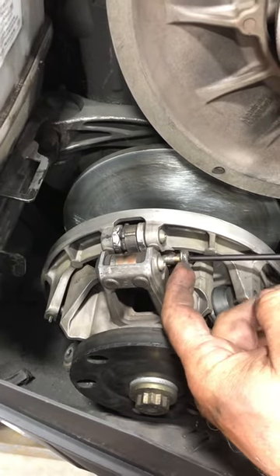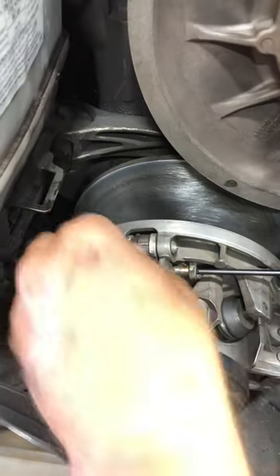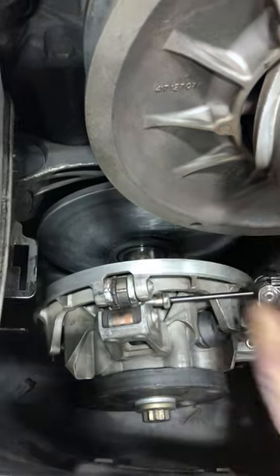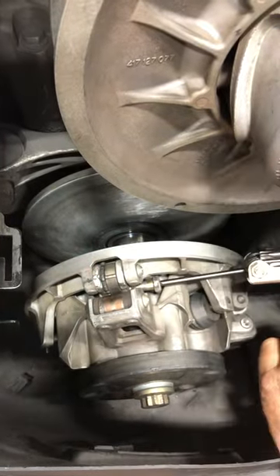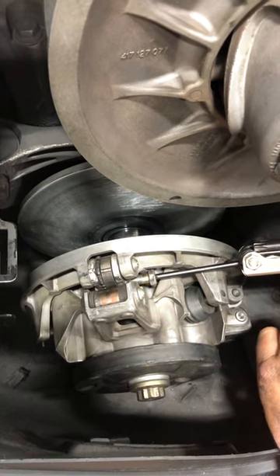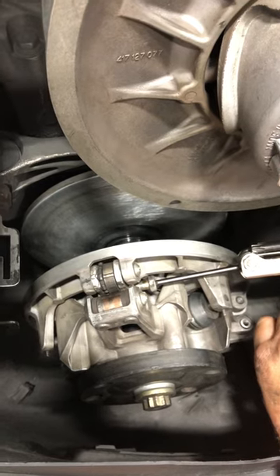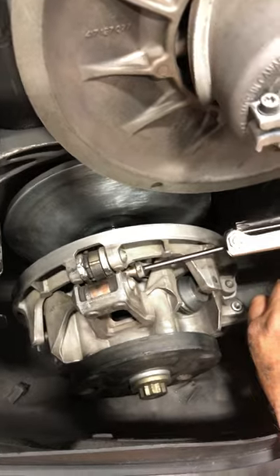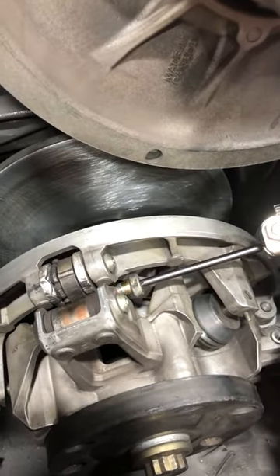If you want to do an altitude adjustment, this is all you really need to do — just like in the old days with the TRA clutches. There's a ratcheting assembly you can change; it's currently on number two and they're available one through five. Each time you move that, it changes the top-end RPM about 200 RPM, which helps fine-tune your sled to keep the engine in its power band.